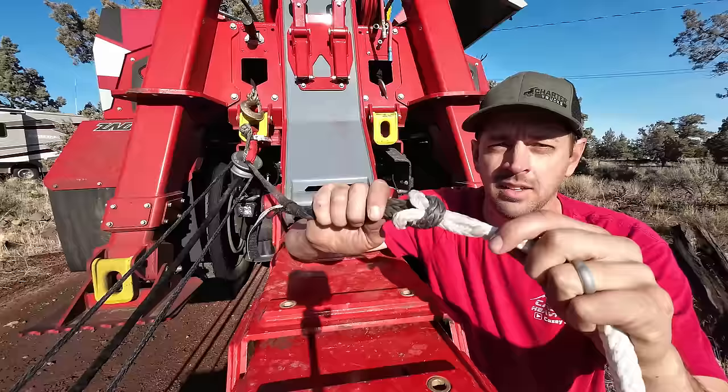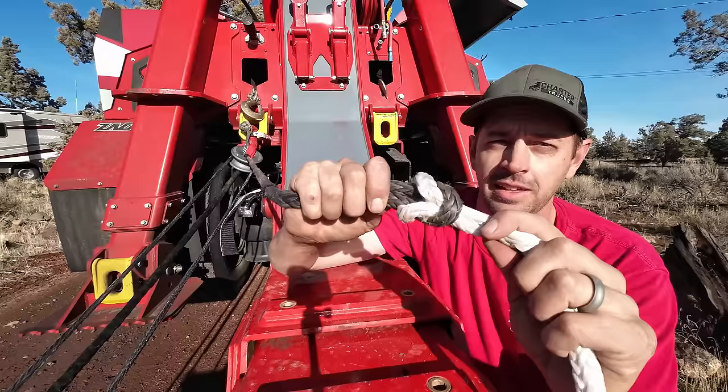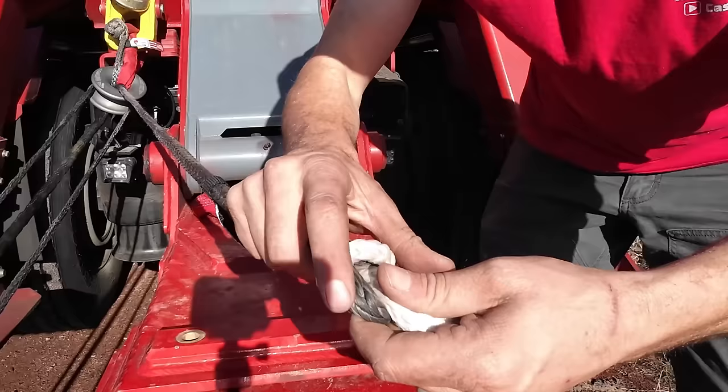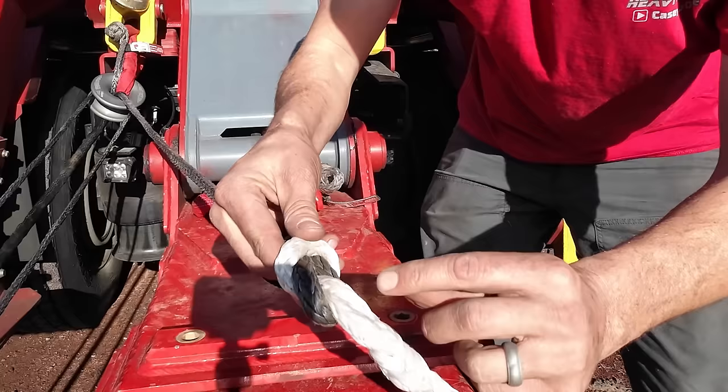This is the most important part of this whole thing — if you're going to pay attention to anything in this whole video, let it be this. This is very, very weak. Do not pull on it yet if we are not ready to start winching. If you just start pulling, you are in very much danger territory of breaking this line. I know that because I watched it happen on a test bed over and over again. When we rolled that line over, we introduced a twist into the extension — you could see those fibers twist almost 180 degrees. That takes the vast majority of the strength out of that line.